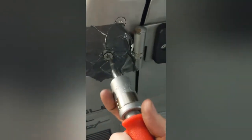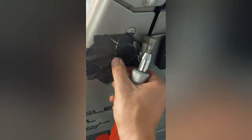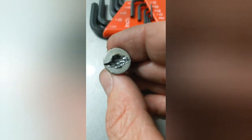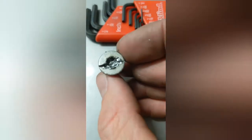The slit method works better than the torx bolt, honestly. The torx thing — I've broken so many. People at Ace Hardware know me by name now because I've taken back three or four Craftsman torx bits — they break off so easily. I just keep going in, taking one back and getting a new one. I got all these bolts off but I broke several torx bits in the process. As you can see — let's get a close-up — there's the slit, and you can see the easy-out bit is stuck in there, but that slit method really works.